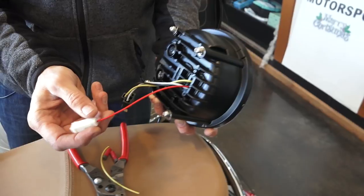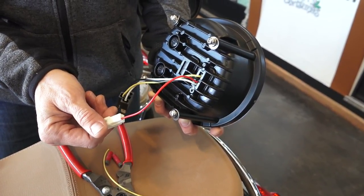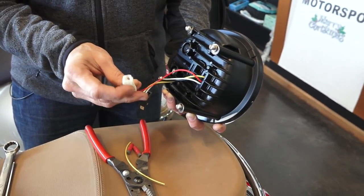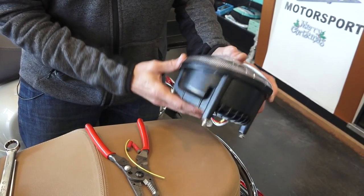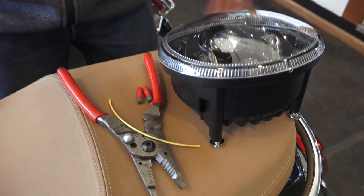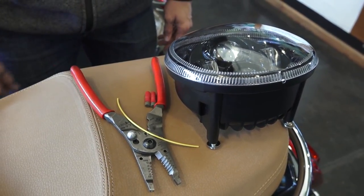There's an extra red wire on this LED housing for the running light. Starting in 2015 on the GTS, they eliminated the running lights on the headlight — that extra little bulb that gives ambient light when you turn the key before the headlight comes on. On prior models there's a connector you just plug right in; on 2015 and later you'll need a couple of extra parts: a wire stripper, a short length of 20 or 18-gauge electrical wire, and two posi-taps, our part number EC01T, to set up the running or parking light.